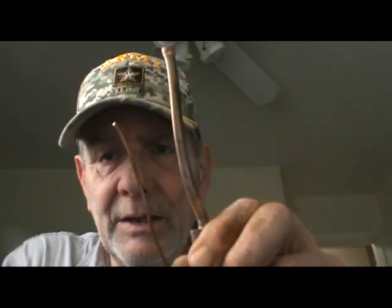If the flame starts to get screwed up on the end, it's usually because there's something in the orifice. It's blocking some of the acetylene. But this tip swirls. It swirls when it comes out, and it wraps around the tube. It's amazing how it works. It's the best tip to use, and it's the proper temperature, proper tool for the job for refrigerators and freezers, anything that is smaller tubing in a home domestic appliance, okay?